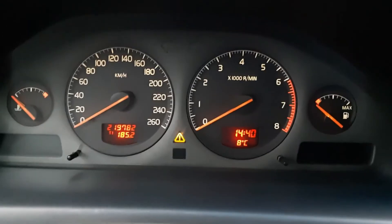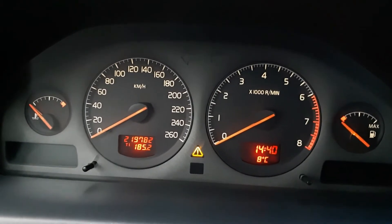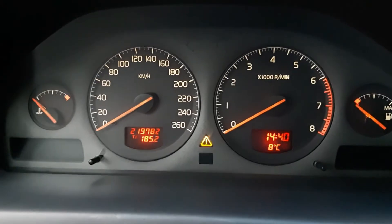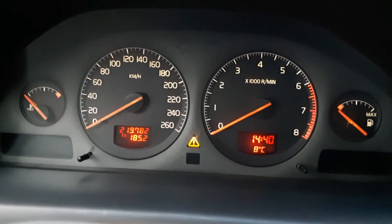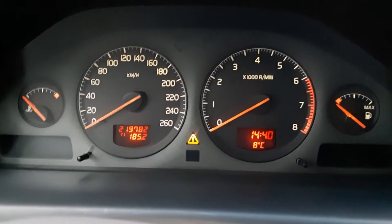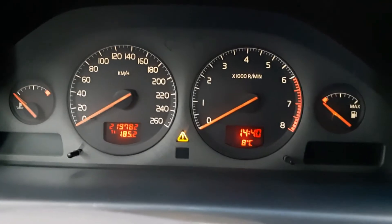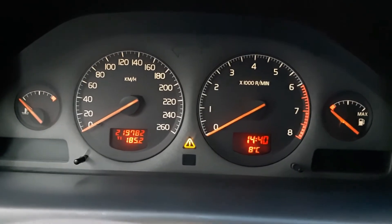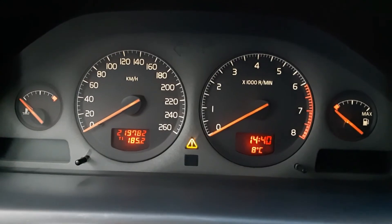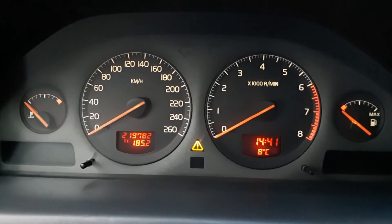So I hope you guys can change the colors and do whatever you want to do — at least be able to read your gauges. If some of the needles are not working for your tachometer or speedometer, that's more significant and your cluster may need to be repaired. Check on Google — there are a couple of companies that will do this for reasonable prices. There's also the option of going to a wrecker and pulling a gauge cluster. Keep in mind that if you do that, you may have to go to a dealer anyway to get them to reprogram it to fit your car. The rebuild is obviously a great idea — send it into one of the companies and get them to resolder or reflow all those solder joints — but that is still going to cost you $500.